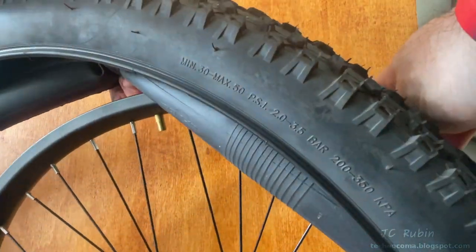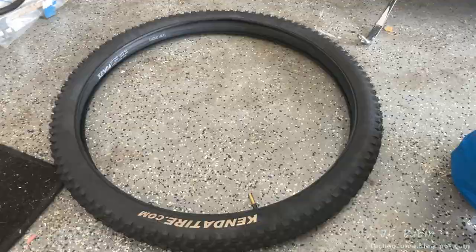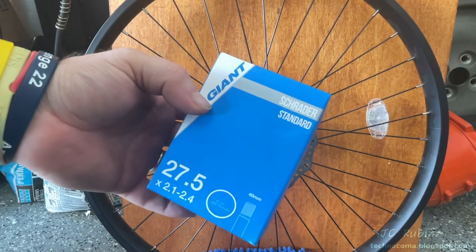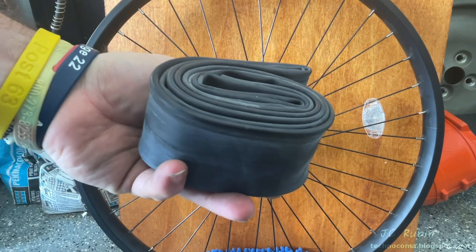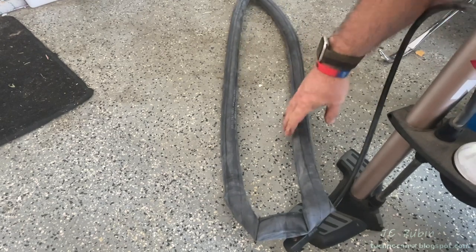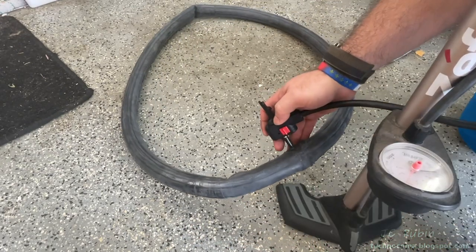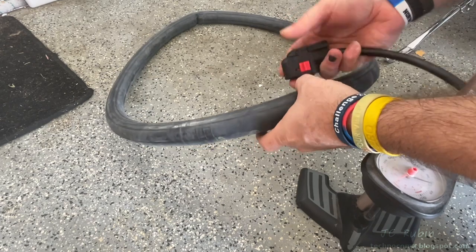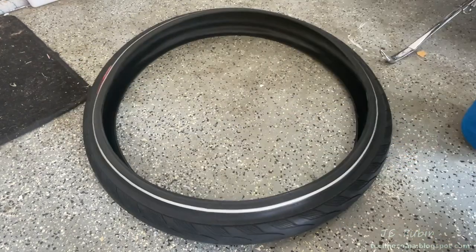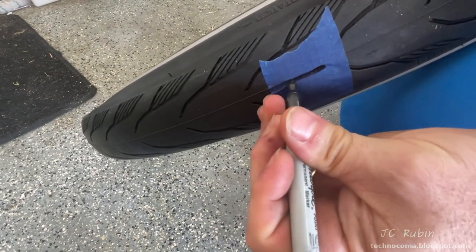I have carpet on the floor to protect the rim — not sitting on concrete. I'll save the old tires and tubes in case this ever goes back to being a dirt bike. Checking the rim strip — hoping it's good since I don't have extra — and it was good. I'm using new tubes from Giant 27.5. I fill the new tube with just enough air to hold form, then remove the label and find the microscopic rotation arrow on the new tire, marking it with tape.